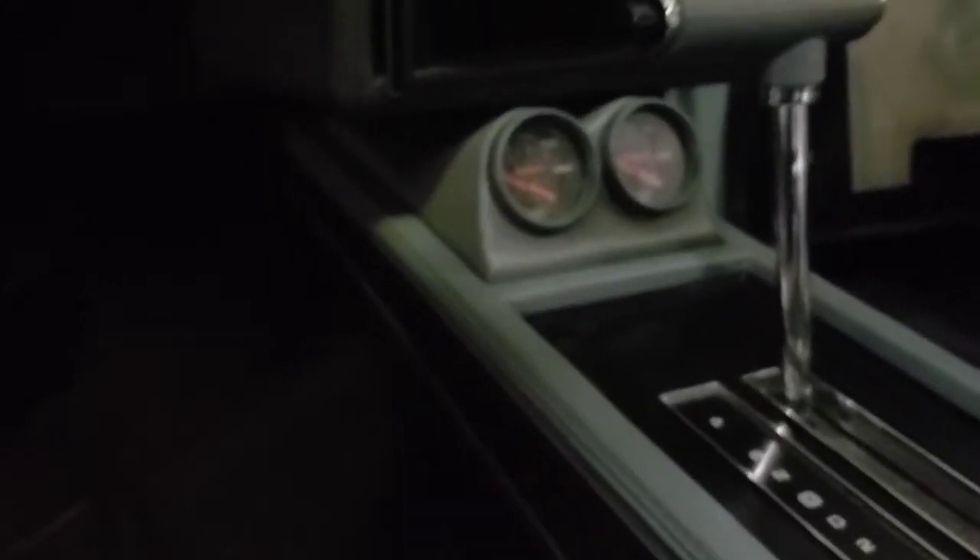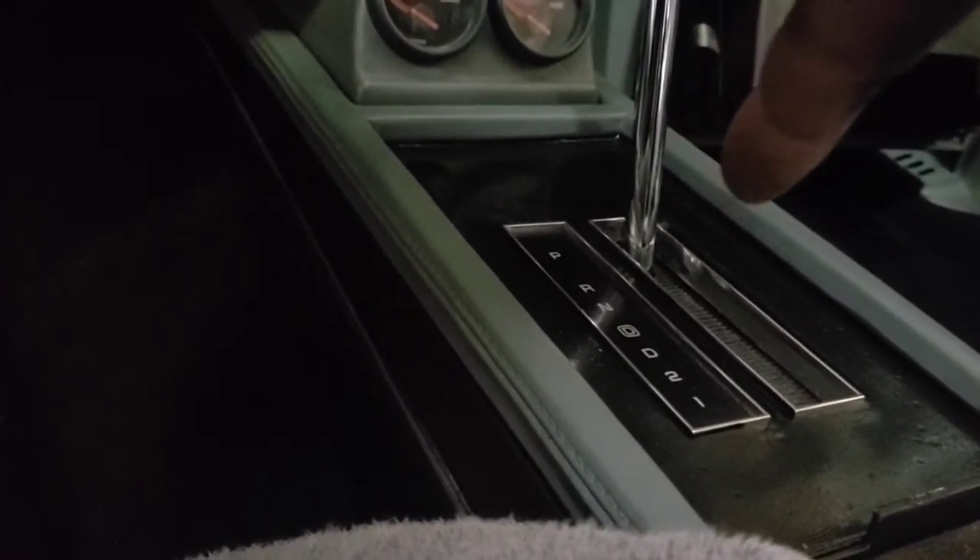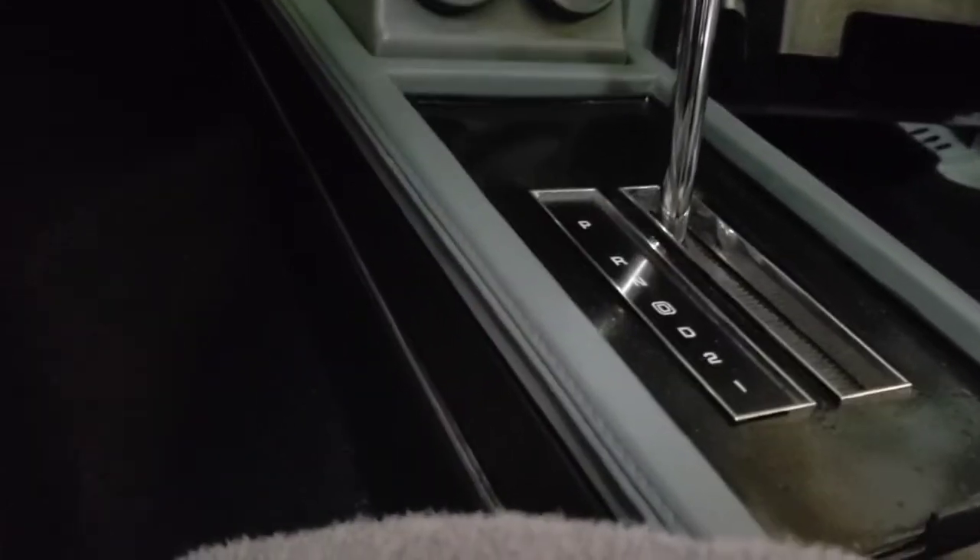Right there we have an ATC jumper that is powering the voltage gauge - you're getting voltage off of it to see what the battery is doing - and it is also powering the knock sense module. The knock sense doesn't pull hardly anything, and the voltage gauge is just reading the 12 volts, so there's no real current draw on that.